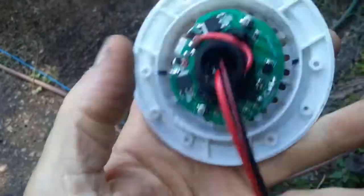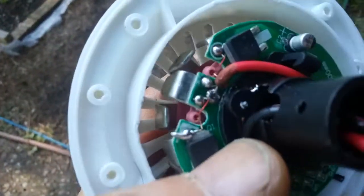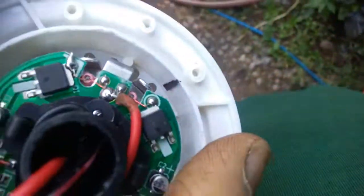That's the DC China mini ceiling fan - it doesn't even say mini on it. I was just trying to buy a DC ceiling fan, it was like 13 bucks altogether. I thought these shiny things were neodymium magnets in there, but they're not. It looks like it's two-phase - it's got two separate pieces of steel where it would swipe by the magnet. What's weird is the magnet was just glued down on four little posts, and I don't know what that line is right here - maybe paint off that magnet or something.